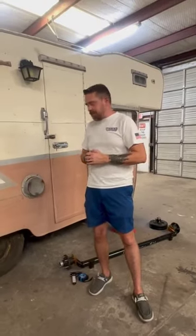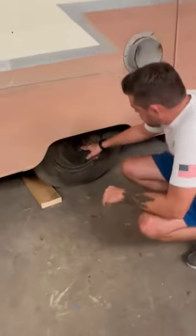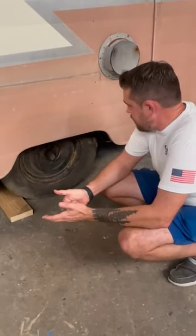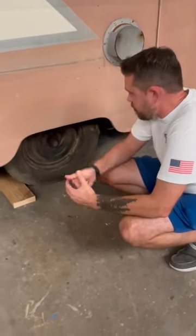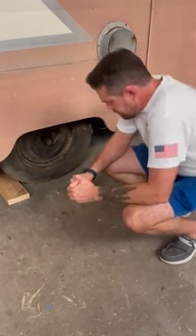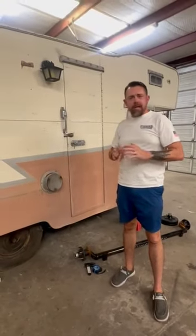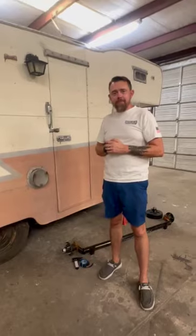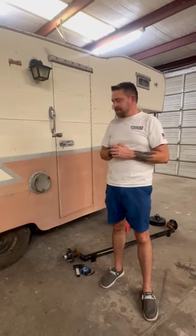The first thing I see them do is take a flathead screwdriver and a hammer trying to knock that cap off. Well, as you well know, or you may not know, these are a threaded cap and it screws in, so he ruined the cap right off the bat. Now, what that does is that keeps all the grease from coming out after you pack the wheel bearings. So he says to me, hey, no problem, we'll just call Napa, we'll get you another cap. Well, you can't get one of those caps at Napa anymore. They haven't been made since the 60s.